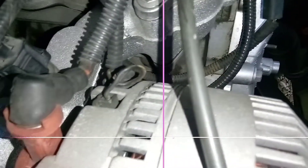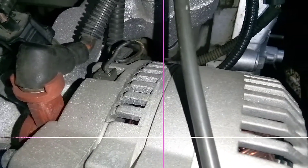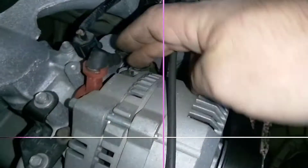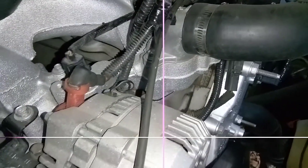That's your excite wire — it's either a field or an excite wire. But if that small wire right here on the top is not plugged in for any reason, you'll lose all charge. You won't have any charge. You'll just have 12 volts from your battery until it dies, and then that's that.